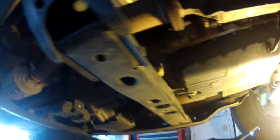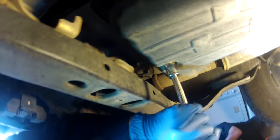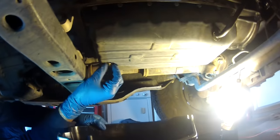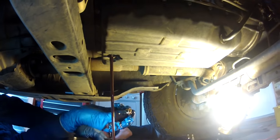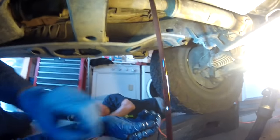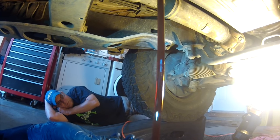I've already got the skid plates out of the way. I'm now going to remove the drain plug on the transmission drain pan. It's a 14 millimeter and I'm just using a 3/8 drive ratchet with extension. Now it's loose. Bring it up here so you have less chance of spilling. It looks fairly dark - it doesn't look too bad but definitely in need of changing.